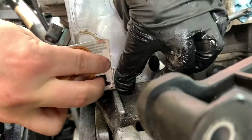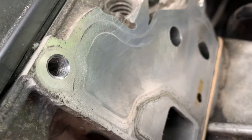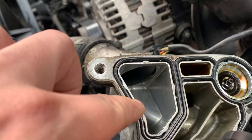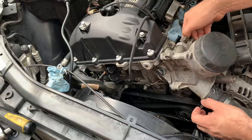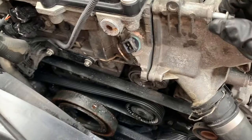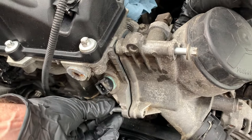I cleaned it as much as I can — probably could do a little better with sandpaper, but I didn't have any. Actually, don't use sandpaper because it could destroy the surface. When you put the new gasket, you'll notice it stands out a bit compared to the old one, which was completely compressed. Now we slap this thing back on. Make sure you hand-tighten these first so you don't cross-thread them.